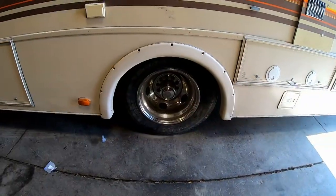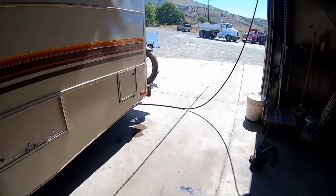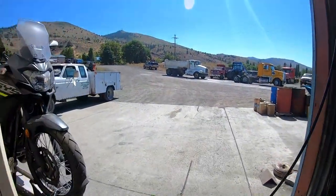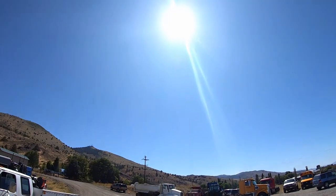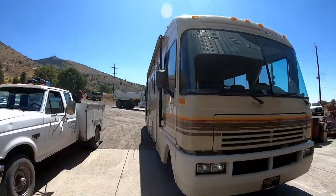We also checked all the tire air pressure — they're all at 95 pounds. The maximum pressure is 110 PSI and I've been running them at 95. They're still holding good. Premium brake pads were only $39.99 for the front set and $39.99 for the rear set. No sales tax in Oregon, so for just under $80 in parts and a few hundred in labor, the Bounder is good to go again.